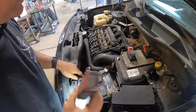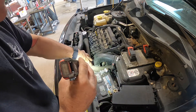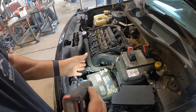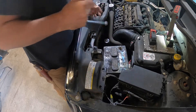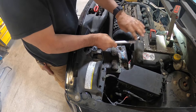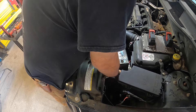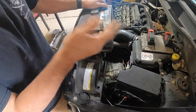One of the things I also like to do — because of the angle of it and I have big hands — I remove this battery so I can get more of a working angle. Some people leave the battery in; I just prefer to remove it. It depends on your ability and flexibility to get down in there. The battery has corrosion all around it — the acid can leave holes in your pants if you get it on your hands and touch your clothes, so make sure you wash your hands. On the battery box there are four bolts and one nut — remove those and the box comes straight out. Make sure you clean it up before putting it back in.